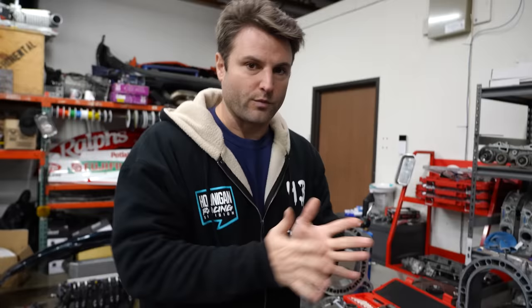If the motor was built to be this way, and now you're adding this material, your bearings are going to be affected. And so, thankfully, I made sure that the top parts got it too, and sure enough, they were just as thick. So the motor technically was an extra 4 thousandths or so longer than it needed to be, but it didn't have an effect on the bearing shapes. We're gonna go ahead and clean all this motor up, nice little peaceful process, repack the rotors, reassemble. This isn't our fight right now. This is just to make sure that the motor's good.